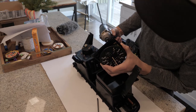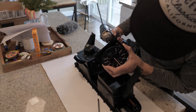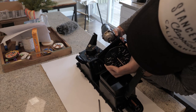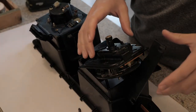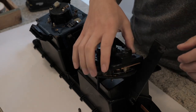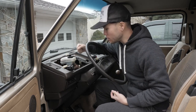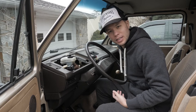The trip odometer is now spinning. Since everything is working appropriately, I'm just going to hit this gear with a little dab of grease and put it back together. Back outside — I've proven that the odometer actually works, so maybe it was just an issue with the connection to the speedometer cable. We'll pop this thing back in and try to test that out.